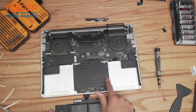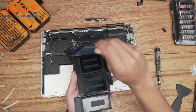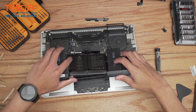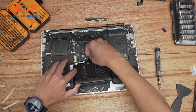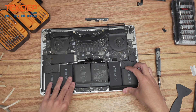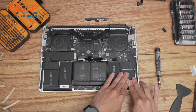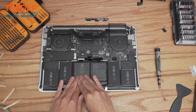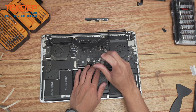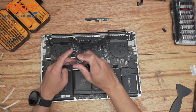Now that the long process of unveiling all of our adhesive is done, we're going to grab our battery and take off this protective coating — this keeps all the glue sticky. The first thing we're going to do is line it up on the inside. I like to snap the connector in first just like that, and then the battery will simply fall in place. We're going to push all around to make sure all the glue is connecting in all the right areas — there's one on the inside here as well as one on the left side. And that is the battery installed.